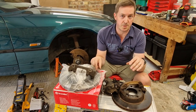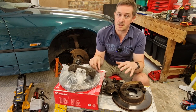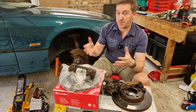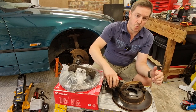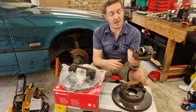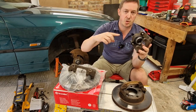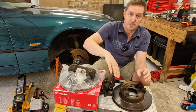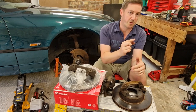You may be thinking that going from 286mm to 300mm isn't going to give a great deal of difference, and you're almost certainly right, but a couple of things happen. We've got a slightly larger disc which means slightly greater mass — unsprung mass is bad — but it also means you can absorb a slightly greater amount of heat before the brakes start to fade. The benefit is that we get to keep the existing calipers, but they sit ever so slightly further out from the point of rotation, which improves the braking force.